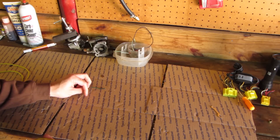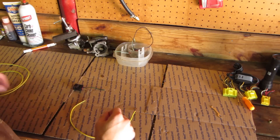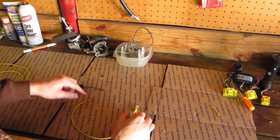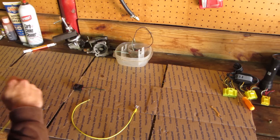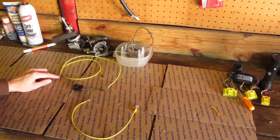The way we do that is we take one side of the switch — it doesn't matter which one — hook a wire into it, use our butt connector, and solder this connection, then ground it out inside the car. We then take another length of wire, solder that connection, and run it to ECU pin 104.